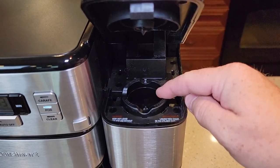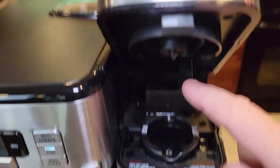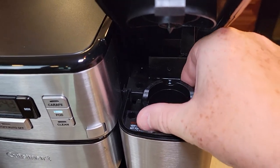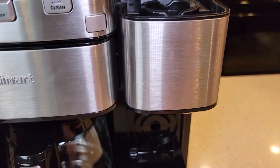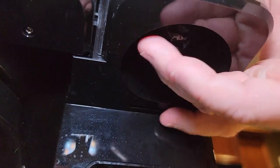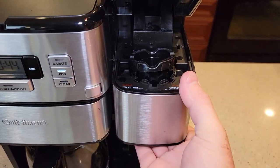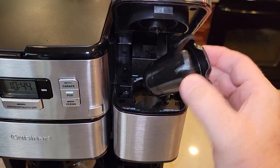The first part I'm going to show you is how to remove the bottom needle basket, and then I'll do the top one. There's the sharp needle — so again, be careful. To remove this bottom basket, sometimes you can grab it here and just pull up. Other times I like to take my finger and just poke from the bottom. There's nothing sharp from the bottom. Just poke on that needle basket right there, and it just pops right up really easy. Then I can grab this whole needle basket and it comes apart.